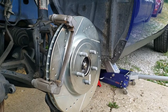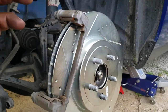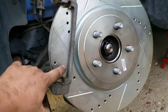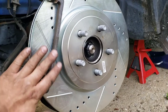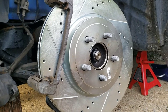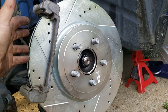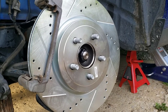There you can see the new rotor — I went ahead and tightened down this bracket. These are 70 foot-pounds of torque for the bracket. Don't touch the rotor anywhere on the surface that the pads touch — front or back. If you get grease anywhere on the face here, all your brakes will smoke and slip. A lot of the ones from the auto parts store come with a sticky, oily film on them for storage — you're going to need brake parts cleaner to get all that off, or your brakes will not work. But these come zinc-plated so they don't rust naturally, and they don't have any of that, so you don't have to worry about it with these.